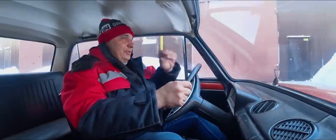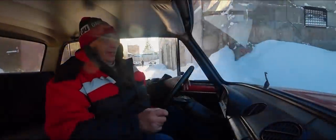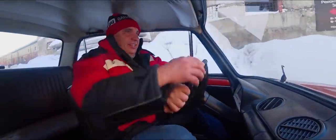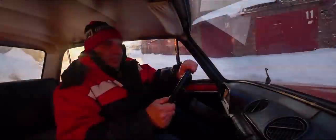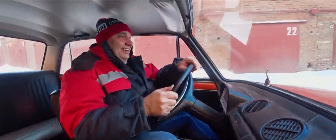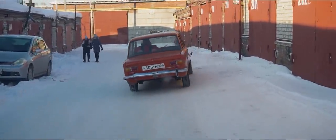You so much as hit a bump, and you can hear some kind of knock - as if the shocks can't handle the weight, which makes sense given that there aren't any bushings to help them out. I can definitely hear it when the strut compresses - the nose dives lower down, and you can really tell there's a drastic increase in the pitch. Otherwise it seems to be okay. The car is a bit more sluggish. Somebody stole our bushings and replaced them with freaking bearings.